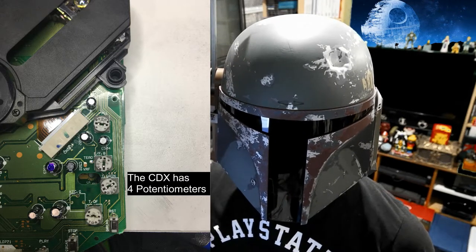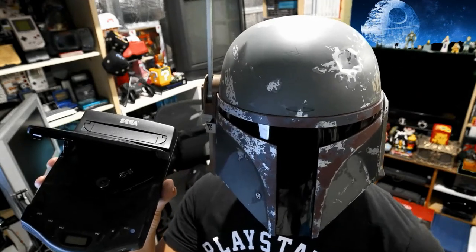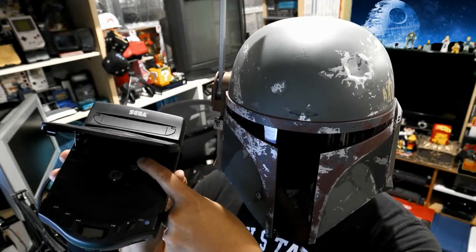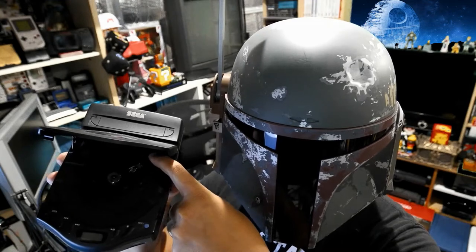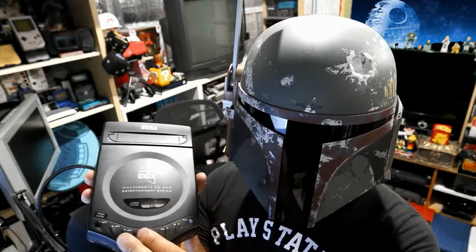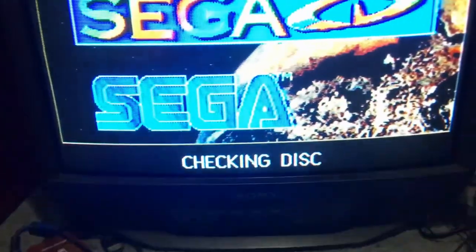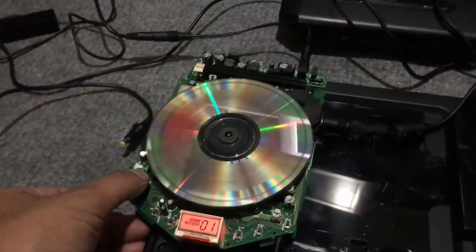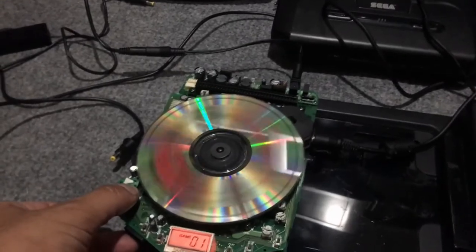That was my thinking as I was taking it apart — I'd have to go in and adjust the dials to get the CD to read. But because I noticed the laser was all the way at the edge and wouldn't move, all I did was slightly take my hand over the laser mechanism head and push it along the tracks to the center of the CDX drive. I booted it up and lo and behold, the disc was spinning and then it started making the sound of reading data — and eventually it read the CD. I was totally blown away.